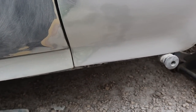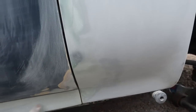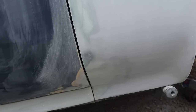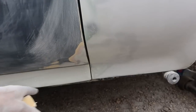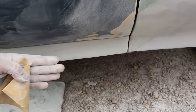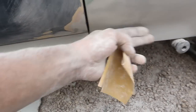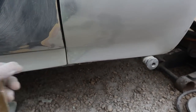To cut up the rocker panel on the car, because this had been repaired at some time in the past and they had kind of just plated over all this and welded the fender right to the car. And anyway, none of it was very correct. So when I put this fender on, which I had made to fit Laura's car, which is correct, it didn't fit with this fender at all. So you can see I've actually had to slice the rocker and kind of curve it all in to match. It's not ideal, but it's better than having the rocker stick out like literally that far.